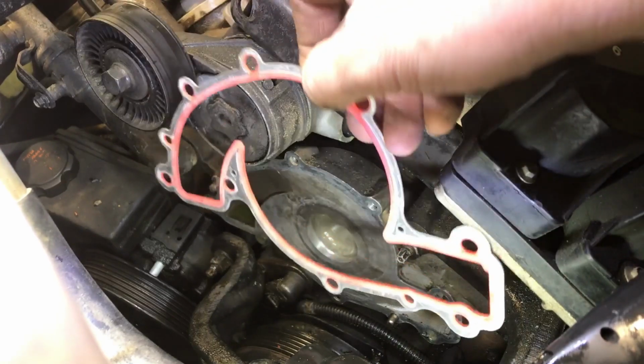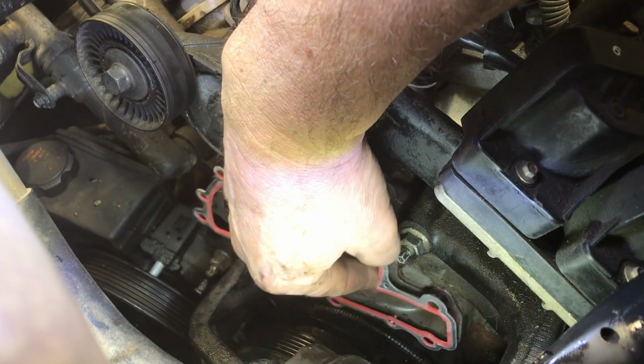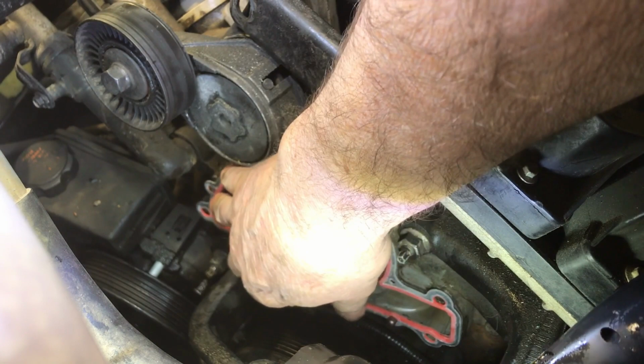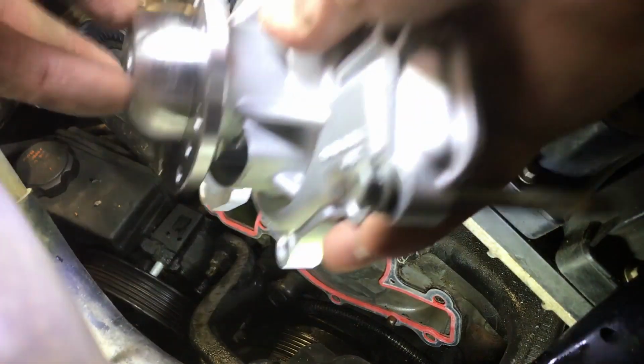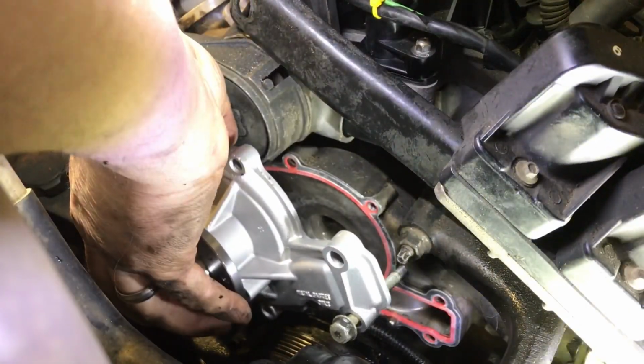I'll put the gasket on, and it's nice that it's a metal gasket, and I'm thinking it'll just sit on these little things. There's a little guy down there, and there's one up there. They're little guides, they're little pins. Grab a new water pump. And we need a bolt. And that bolt was down there, wasn't it? I think it was the bottom big guy. So I'll just try and sit that in there. Just like the way we took it out.